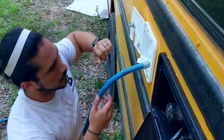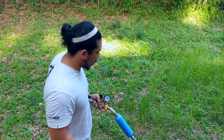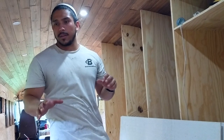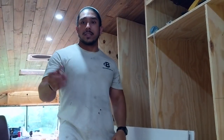Alright, it's hooked up — now I'm going to turn the water on. As you can see, it jumped from zero to around 30 PSI. The water pressure here isn't super great but I can adjust it up and down. Although we do have check valves, I want to make sure nothing goes back where it's not supposed to. In the meantime while doing the city water pressure testing, I'm going to take the fuse out for the pump so water doesn't accidentally go in there. It's always best practice that whenever you have city water hooked up, you have your pump turned off — that's why it's good to have it on a switch.